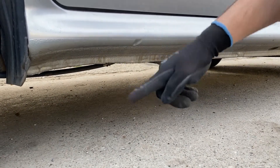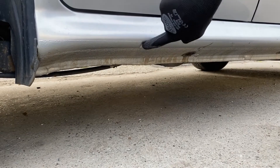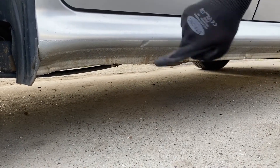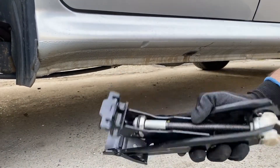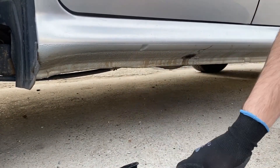As I am changing the rear wheel, in this area I find the jacking indicator for this specific model — in this case, the Skoda Octavia Mark 1. You'll find a similar one in the front as well. And this is how you are going to put the jack. Here is the exact point.